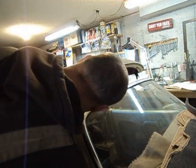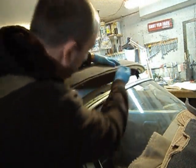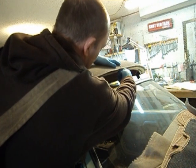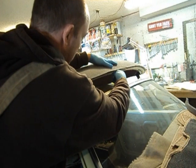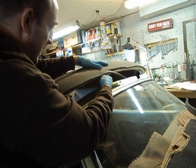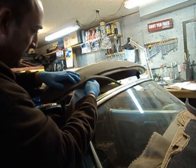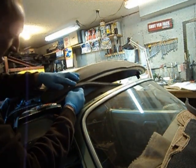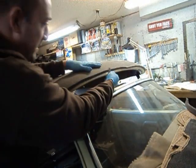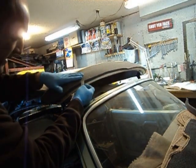Turning our attention back to the front of the car and trimming up this foam. I always work with a brand new razor blade when I trim stuff like this — I buy them in boxes of 100. They cut really sharp right out of the box and then start to dull up. At two or three cents a piece, it's cheaper to make one big cut really nicely, then throw the blade in the trash and get another one. You don't get a second chance at some of this stuff. That made a pretty nice cut — our fabric is going to come right down against it so we want it nice and even all the way across.